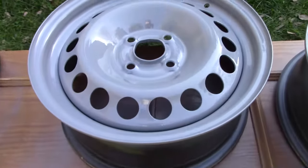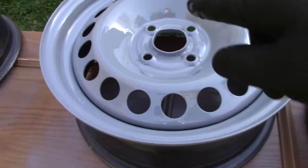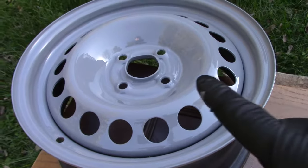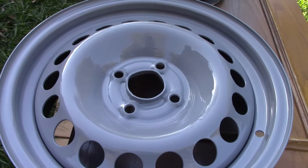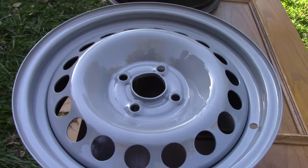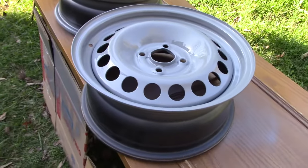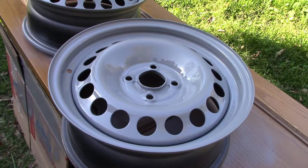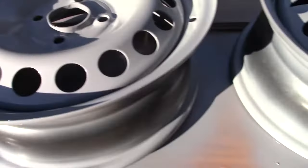But yeah, I get this really smooth finish. I've done this with spray cans many times, but this is my first time with a gun. I just get the super smooth finish by making sure it tacks between coats, and overlapping each pass, I should say, with about 70% overlap. But just kind of getting a feel for not too much paint. I think these are going so well because I basically made the same spray pattern as a spray can. I'm feeling like I'm just shooting spray cans at this point.